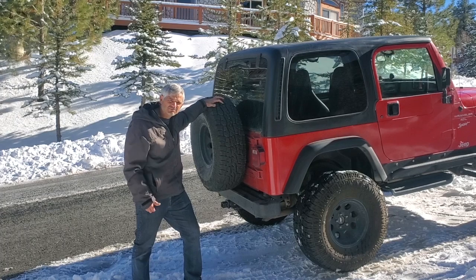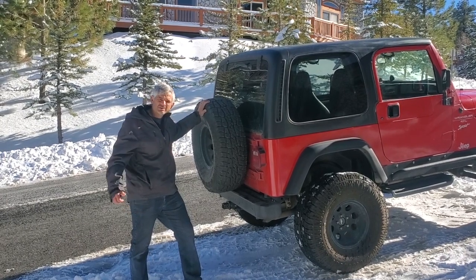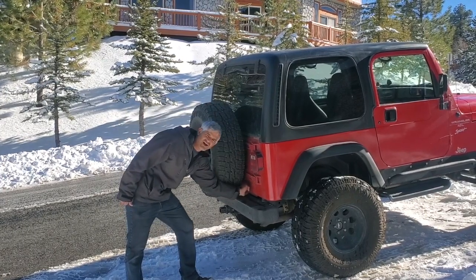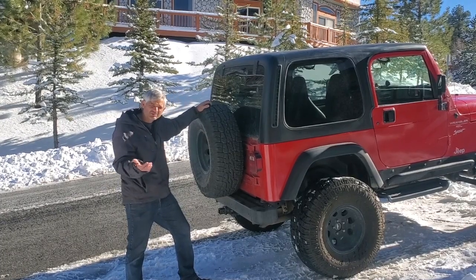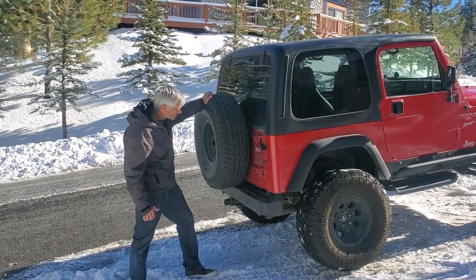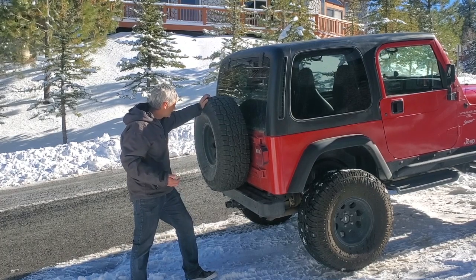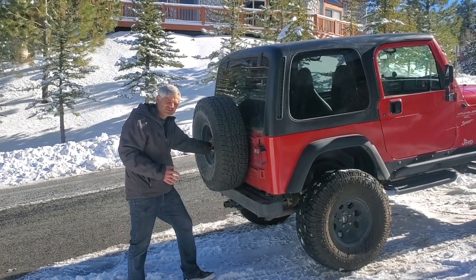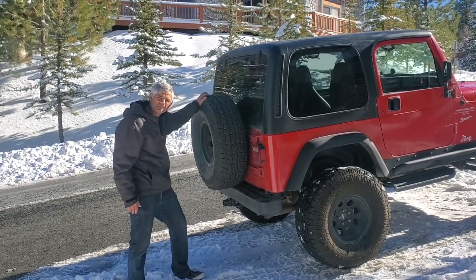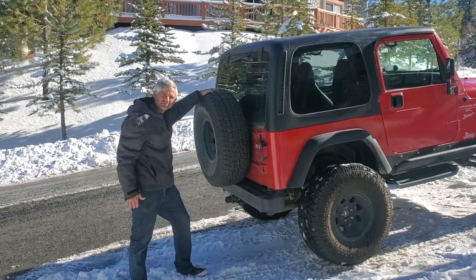I've added small spacers behind those bumpers to make sure the tire is fully secure and doesn't rattle at all when the gate is shut. That includes the bumpers on the gate itself, as well as a very important bumper that sits on the frame and supports the bottom of the tire. When going over rough terrain, the tire will bounce and almost want to peel back off and cause cracks. So one of the most important bump supports is the one that sits on the tub and holds out the bottom of the tire. By adjusting how the tire carrier is mounted to the liftgate, I have it adjusted so the tire is actually resting on the bumper — the weight of the tire, when pushed down, is being supported by the bumper as well as the rubber bump stops.